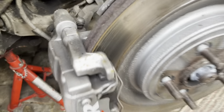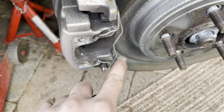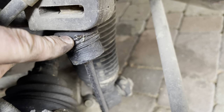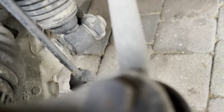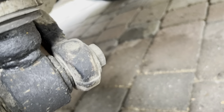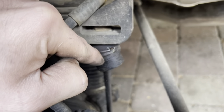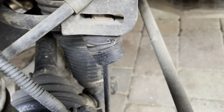Let's have a look at what we need. I forgot to take this retaining clip off. And look at these drop links — they're only three years old. Look at them. This bottom one's gone as well. I noticed this a few weeks back when I was doing the exhaust, I thought that one looks a bit nasty. So I'm going to have to put some new drop links on. I can't believe they're three years old. What a joke. And they were proper Jaguar ones.